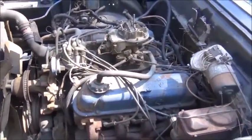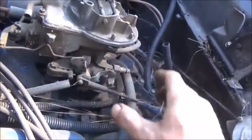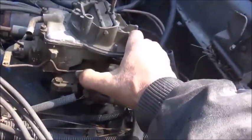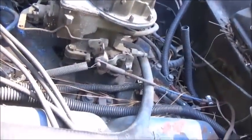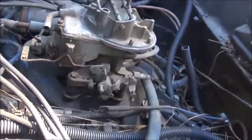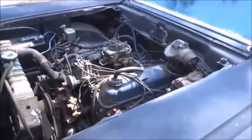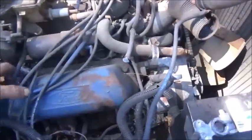Anyway, we're going to get at it here. The throttle is stuck tight so I don't know what I'm going to do about that. Oh man, it's stuck real tight. We'll definitely have to get the carburetor off and figure out what's up with the throttle plates. But first we need to make sure the engine rolls over - the last thing we need is a stuck engine.